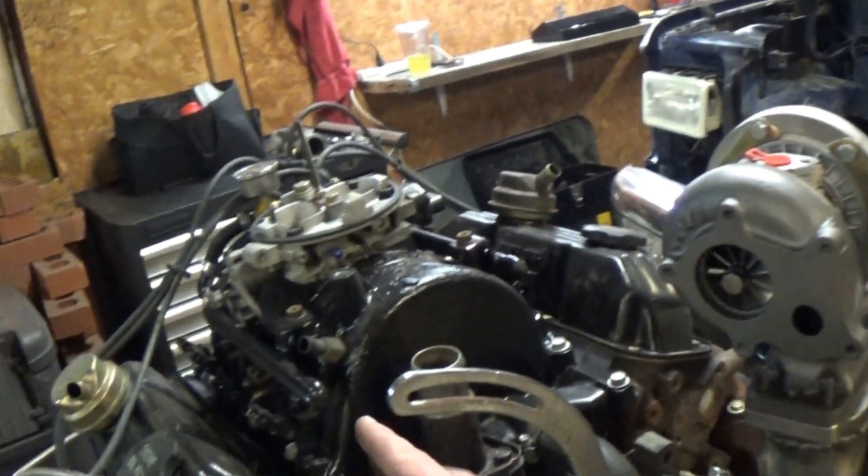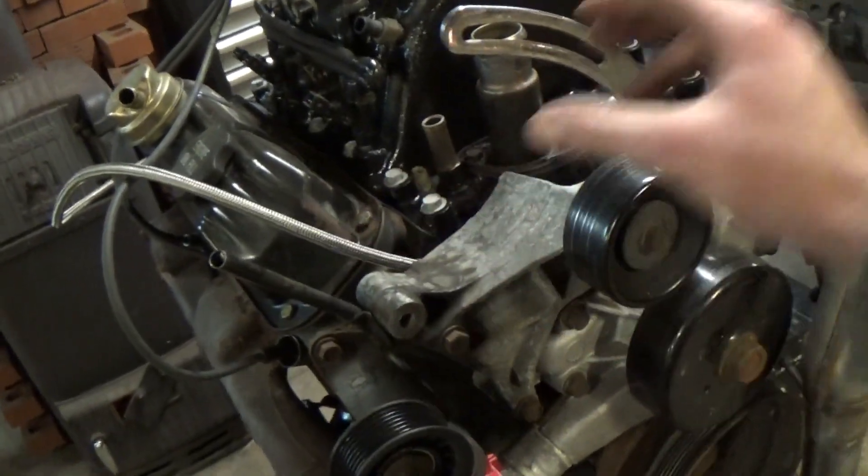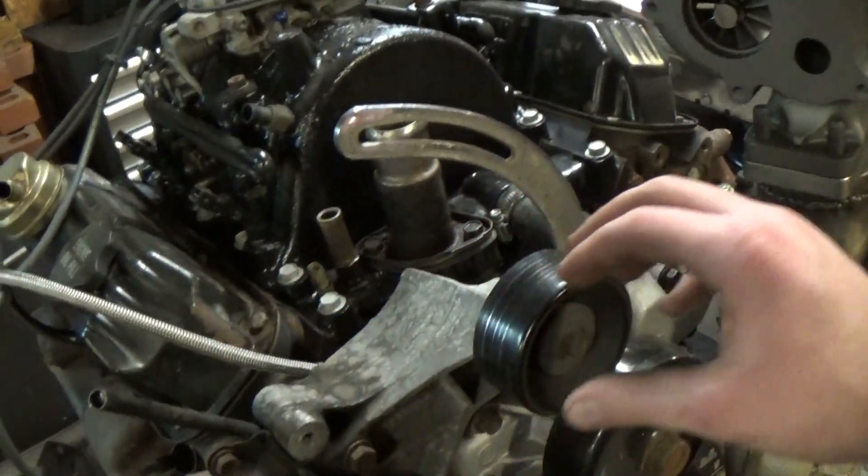Actually, I've got to do the oil drain before I do the downpipe — I forgot about that. So we'll do the oil drain after the support bracket is done, then we'll do the downpipe and kind of get that portion of it finished. I need to get the alternator bolted back on so that I can figure out how to route the downpipe around it, because the alternator pulley sits kind of here and I'm going to have to figure a way to get the downpipe around that.